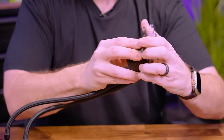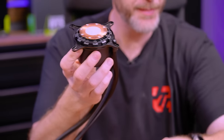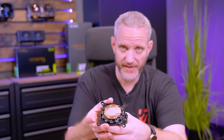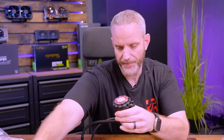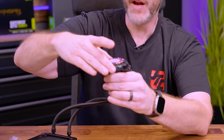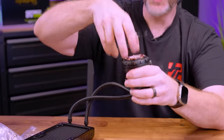Here is your pump. It has pre-applied thermal paste, so keep the cover on until you're ready to mount it — it does not come with a tube of thermal paste. I'd highly recommend having a tube on hand in case you scratch it and need to reapply. When it comes to switching the bracket, the Intel bracket is pre-installed. You can just push down, turn, and it comes off. Then install the AMD bracket just like that — that fast you convert it over to AMD.